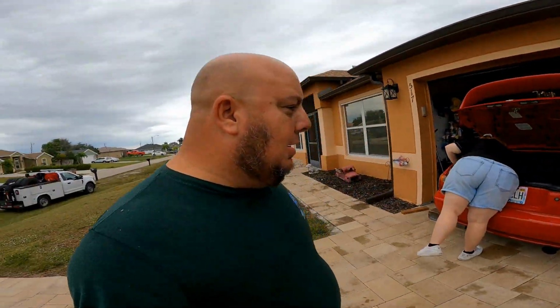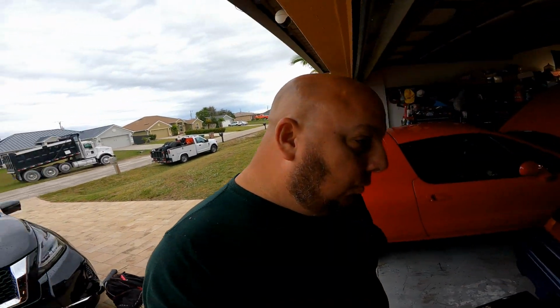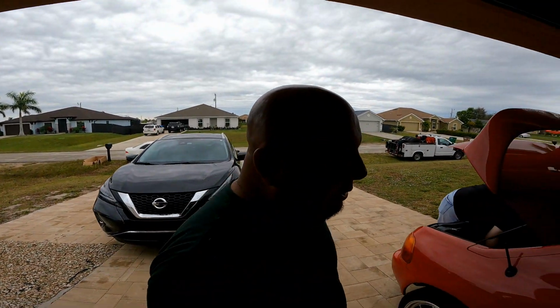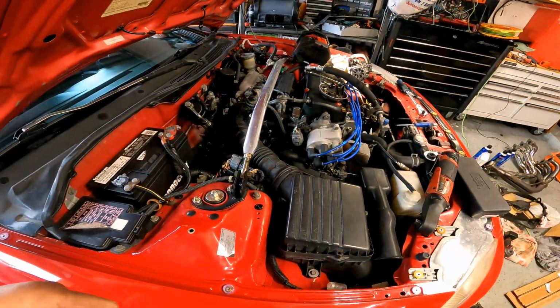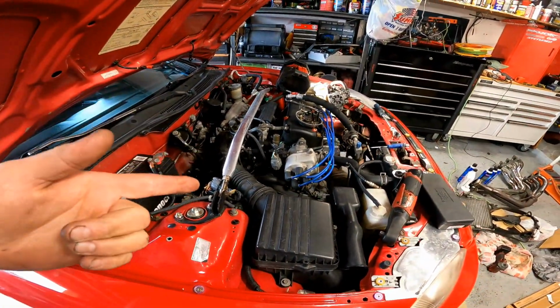All right guys, so we had been working, the guys have been working hard on this. The oil pan is done. Remember, the sequence is only 9 pounds to do that. And then do the sequence, the 18 bolts in there, so you have to do a sequence on that. Colin right now is doing the oil drain plug. Of course, we use the Honda filter for this. And after that, we're gonna fill it up.